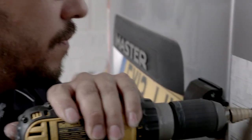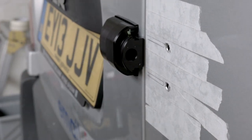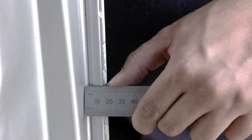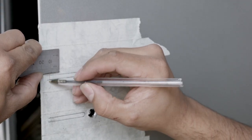Using the step cutter, we will drill the two fixed hole positions ensuring we do not exceed 8 millimetres in diameter for each one. For the other two fixings, these will need to be located through the door overlap. To calculate the fixing positions, we will measure the depth of the overlap. Halving this measurement, we can transfer it to the outside of the door skin and mark it within the slotted area we have already obtained.